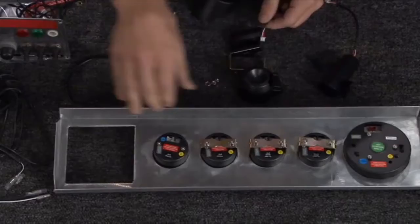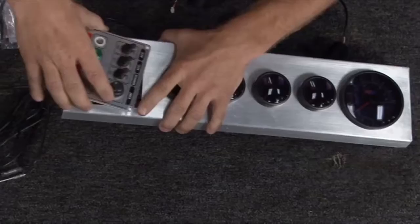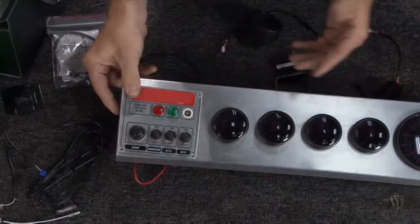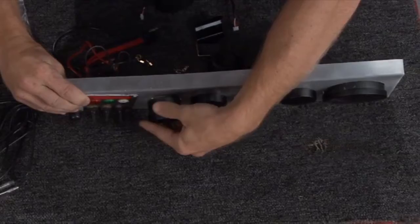What makes it really neat is they come with a complete wiring harness with some great functions. For power, you bring it into one of the gauges as your first connection, then from there you simply jump each gauge to the next and transfer the power down in a series — you don't have to bring it in from one single source over and over again. Makes life really easy. You've got your sending unit which plugs into the wiring harness and that simply plugs into the back of the gauge — nice, easy installation. This big cutout here is for our switch panel, and it goes off to this side because the master cutoff switch in the truck is right below it. This way all your switches are in one place. If you have a problem, you can cut off all the power in one spot.